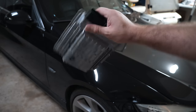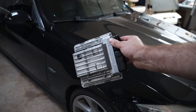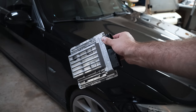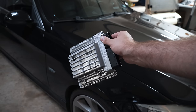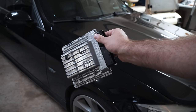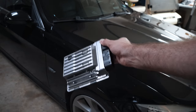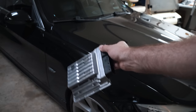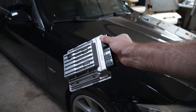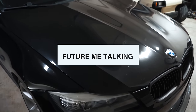A bit of backstory here — this is my MSD80 ECU. I recently upgraded to an MSD81, where they fixed some known issues. I did that because I was hoping the issue lied with the ECU; even though I changed the MOSFETs, I was getting some misfires up high. But what actually happened was I replaced the ECU and right when I put the new one in, it told me that my secondary O2 sensors were bad.